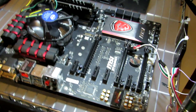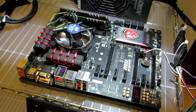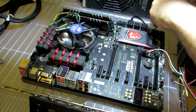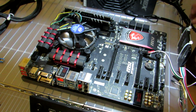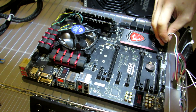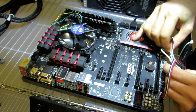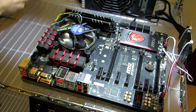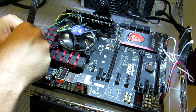I've got the board in position here, ready to start plugging in all the power and GPUs. I'll hook up my SSD, plug in the SATA connection, plug in the power connection for it. Cables can be quite a mess so I try and tidy them up as much as I can. I'll plug in the audio, USB, power, restart, get my motherboard cable plugged in, and the CPU 8-pin. This power supply has 2 CPU 8-pins and 9 8-pins for VGA.